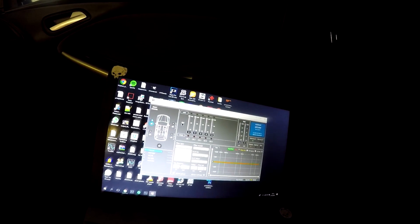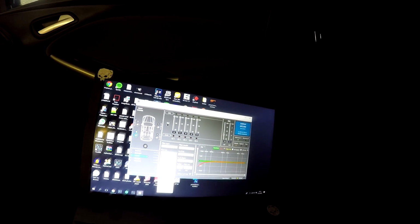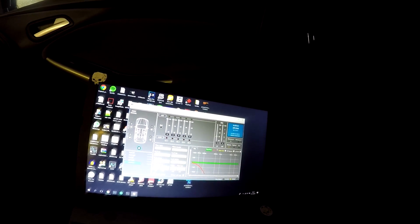It's all ready here, but we want to add additional things. We go up in here, take settings, working mode to expert, so we can check the filters correctly. Front left filter, we want it to have a high pass down to 40 Hz, so we don't want to play the sub frequencies at the front. Also at the rear, we go here and high pass from the 40 Hz up. And then check the subwoofer with a low pass of 80 Hz, 12 dB.